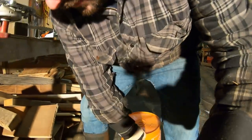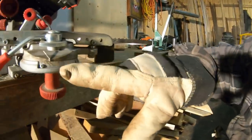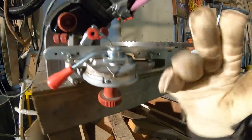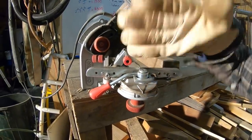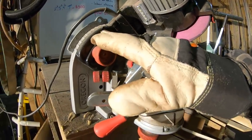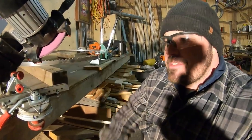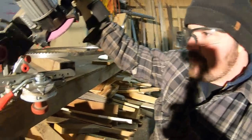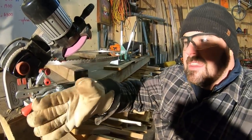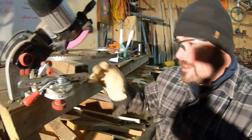In the manual that comes with this thing, there are settings depending on the chain you're using. I've got this already set up — I tend to go about 25 to 26 degrees on this angle here. The other angle tilts backwards at about 10 degrees, and then the head angle — I think it's about 55 degrees. The chain doesn't actually have to come off until it's sharpened on both directional teeth, which is very handy.